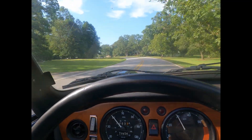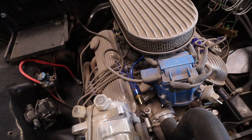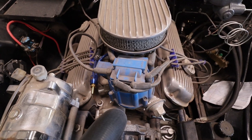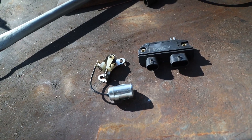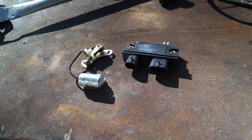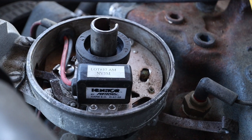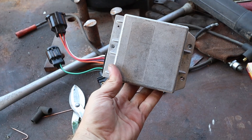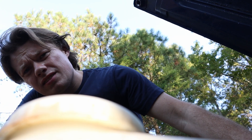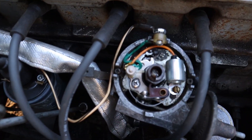So we've heard some pros and some cons of points ignition and electronic, but what is the bottom line? I think if I had to sum it all up, I would say there's no arguing that electronic ignition has a lot of distinct advantages. However, if we're talking about upgrading from points to electronic, I just don't see the economic value. Because as good as electronic ignition is, it does have a few distinct disadvantages, especially when it comes to diagnostics and repairs. Points ignition was meant to be fixed by the consumer, and electronic ignition was meant to be fixed by the dealer. So the next time you find yourself staring down at a set of points ignition, keep your wallet where it is, take a breath, and give them a chance. Because if you do, I think you'll find that the ultimate reliability comes from keeping it simple.